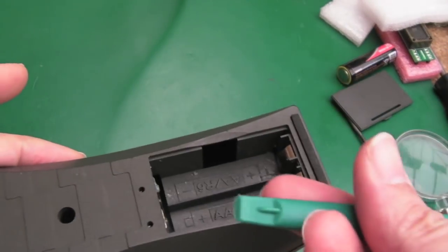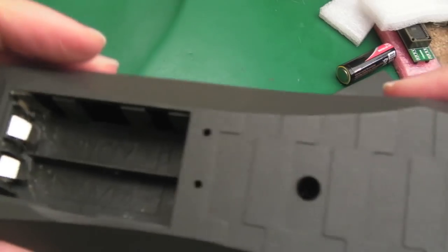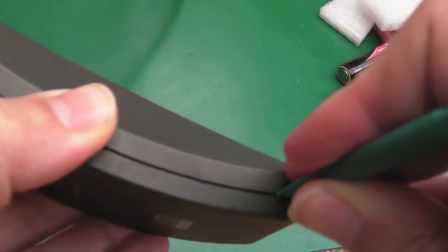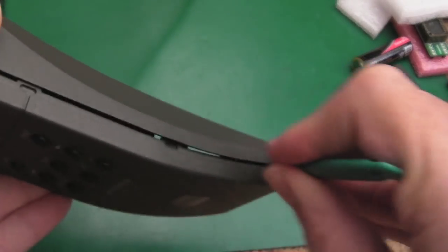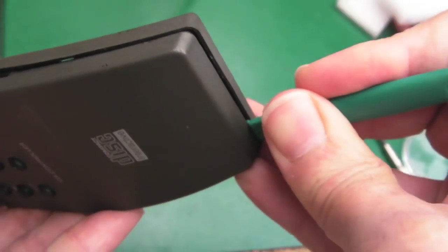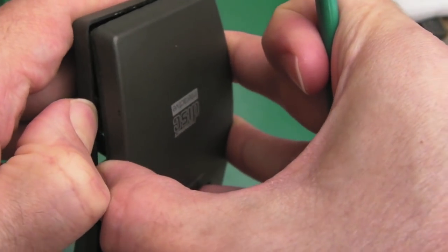So if we just use an iPhone removal tool — this is designed for getting into an iPod, I think, actually. I think it's going to be clipped around the edges somewhere here, because there are no other screws. Yeah, it stands to reason it's clipped. All I did here is slide this down here like that, and you can see it started to separate a little bit. Can you see the clips? Just take your time when you're doing something like this — the last thing you want to do is break it. Oops, and it snapped off there. It's that really fragile type of plastic, so I wouldn't be surprised if I break one or two of these clips as I go around.